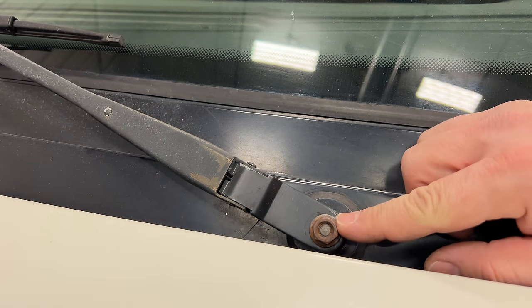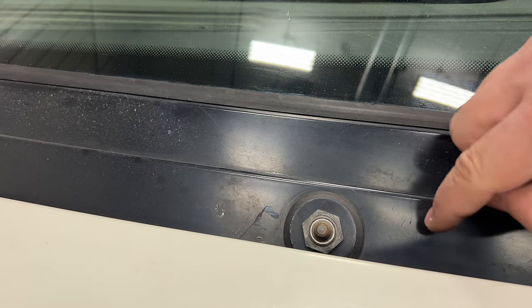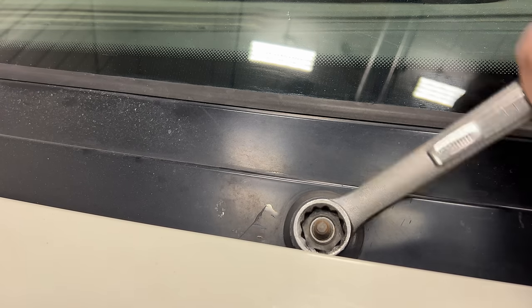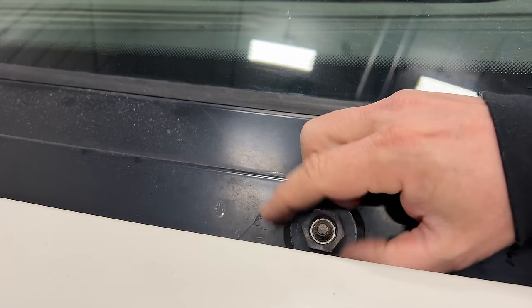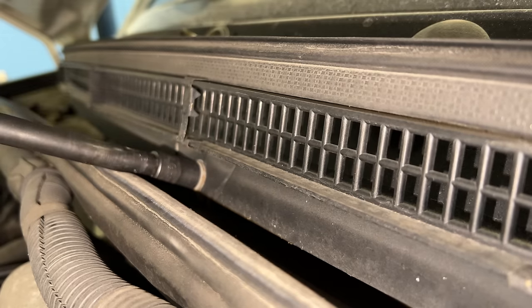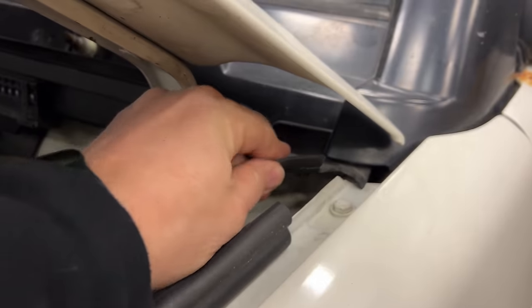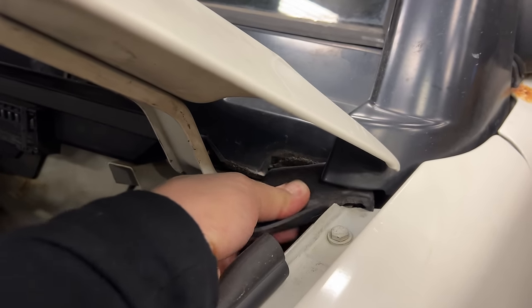The first thing I'm going to do is remove the wiper arms completely. Now I'll remove this nut which holds the wiper unit to this piece of plastic, and then underneath that is a metal washer. And then under the bonnet there is a single bolt right here in the middle. Now I'm going to pull this little rubber piece out of the corner here. This is going to loosen everything up so that I can pull the cowl out.